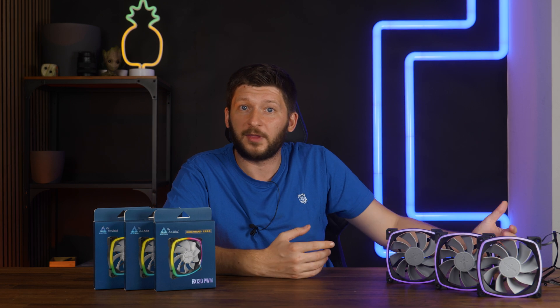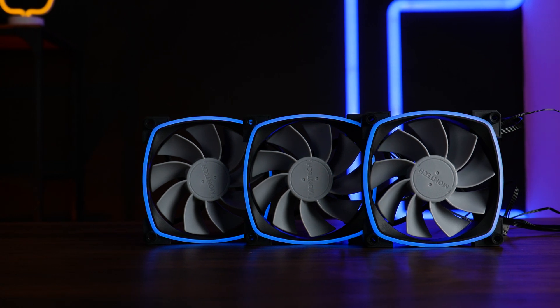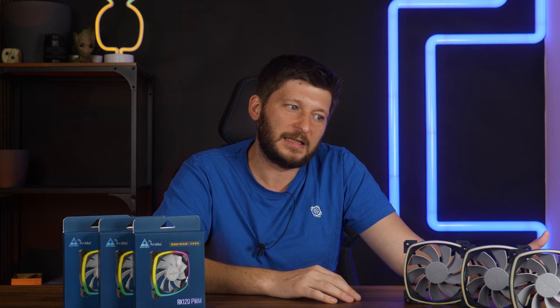For this test we used the original layout, meaning air goes in and comes out at the same spots. The reverse spinning fan got the special treatment of being turned around so everything still works — no fan was closer or further away from the heatsink. So did Montech lie on their spec sheet? Not necessarily. I still believe that numerous fans out there have performance values — airflow and static pressure — calculated using the blade geometry and speed, with nobody actually measuring true performance after production.